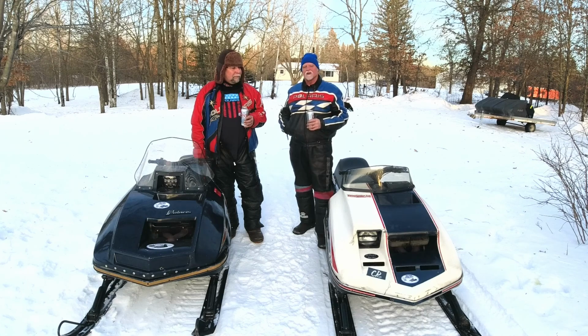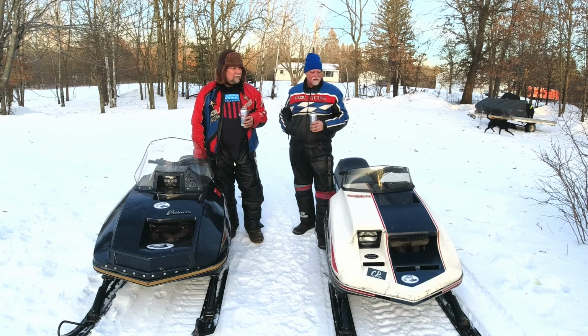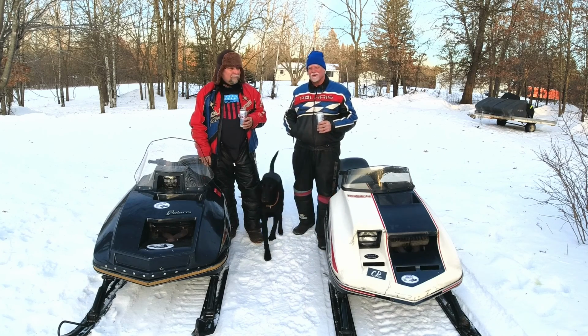So it was set at 290 and 310. We decided after discussion to make them both 290. We talked about going back to the 280, which is stock, but with a gutted air box on there, we really think that we're better off staying at the 290 so it doesn't lean out. As Mr. Nutter says, spark plugs are cheaper than cylinders.